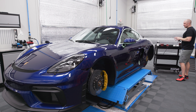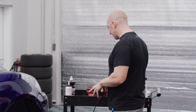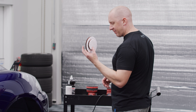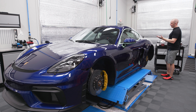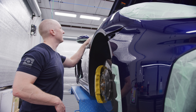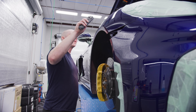I'm deep in the throes of polishing. I've done most of the car, did a test panel and all that earlier. Here's the combination that's working: I'm forcing myself to use the Flex tools on this to continue developing a skill set around them. I'm using microfiber because the paint is pretty hard on this car. I tried yellow with Sonax Perfect Finish — that didn't take it all out. I tried yellow wool with Jescar Correction Compound — that didn't take it all out either.